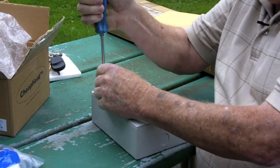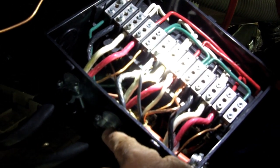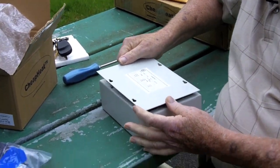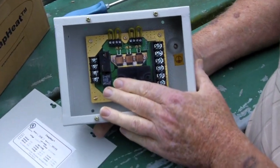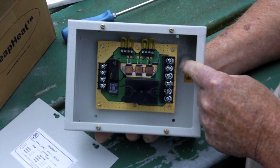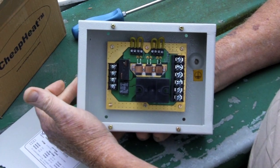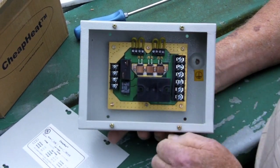One of the nice things about this controller is it's designed to work on either the 30-amp shore power services or the 50-amp shore power services. Plus, it works on all the heat ranges that you have with the heating coils, so it's kind of a one-fits-all thing. If you look inside, on this side we've got where our line voltage comes in and comes out — this is where it's going to feed the heater element. And here is where our 12 volts comes in from our thermostat, goes out and runs our fan in our furnace. In here, this is our speed controller for our fan.